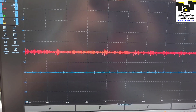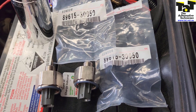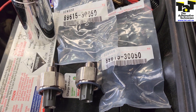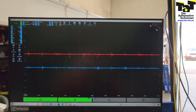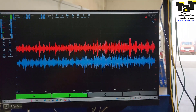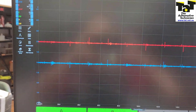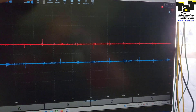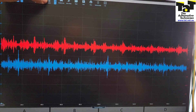As you can see, the number one sensor is not producing a signal at all, which clearly shows we have a fault with that sensor and need to replace it. After replacing the sensor, here is the after-check while revving — the blue trace for number one is now working normally. Looking at the signature, we can see an AC sine wave, and that is exactly what we're supposed to be getting — that is what a normal knock sensor signal looks like.